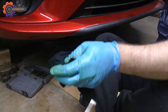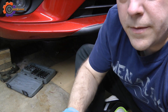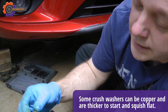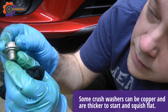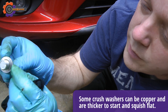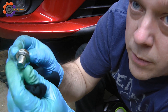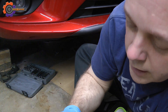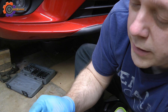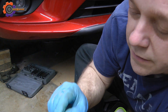I'm going to let that drain for a little bit longer. What I want to show you is that some of these pan bolts have a crush washer on them. It's hard to get off because it has a little layer of film that kind of sucks that washer on. You want to make sure that you get that washer off and not reuse it. Some people do reuse them and that would be okay in this instance, but to show you how this works I'm going to need to get a little knife in there to pull that off.